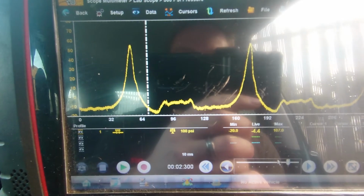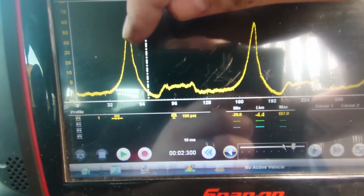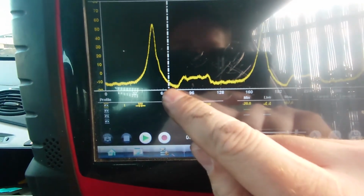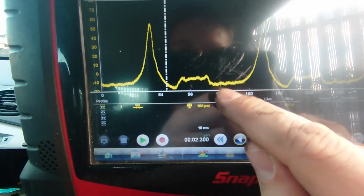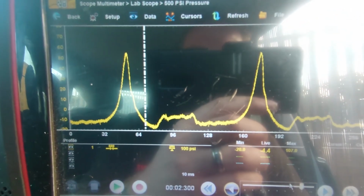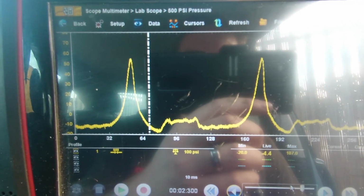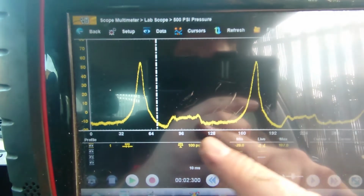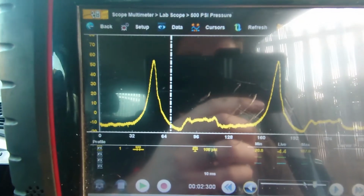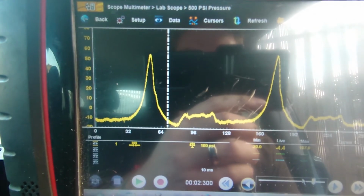So I don't like the look of that initially. We've got leaning towers here. I've got uneven pockets on the bottom here. These should be the same as well. So I mean there's a few flags going there straight away for certainly compression loss. We'd have to chuck it up on a compression graph to see exactly when these valve timings are.